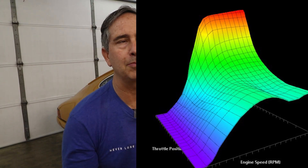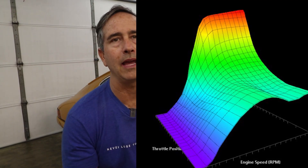So it's pretty hard to describe the whole tuning process in just a couple minutes, but the highlights are: I basically took the timing curve from like a 1982 SC — those are published in the workshop manual — that's a pretty conservative baseline for kind of moderate to full throttle. And I typically bumped up the timing a little bit in part throttle conditions, just like vacuum advance was. This is a 3D curve showing the timing map, and it's pretty conservative.